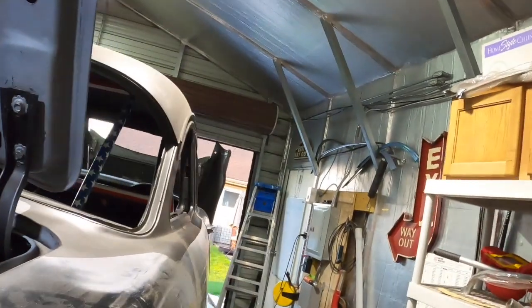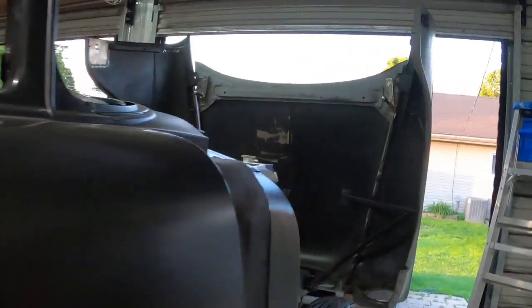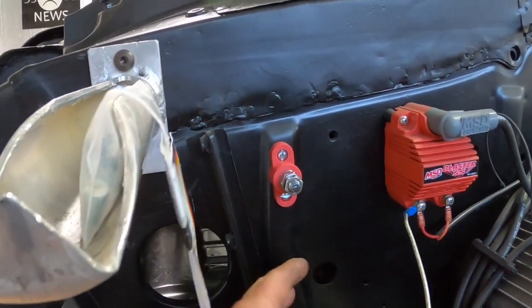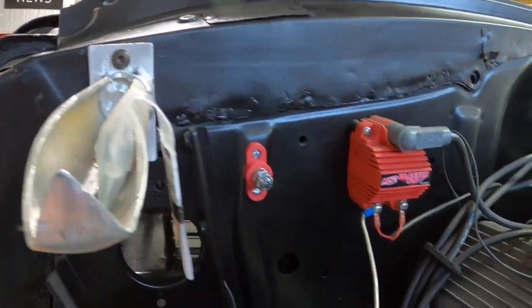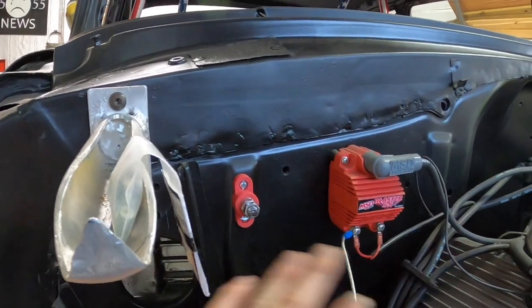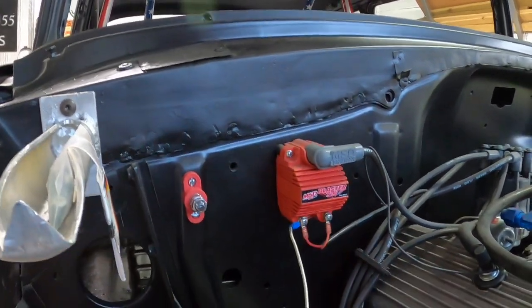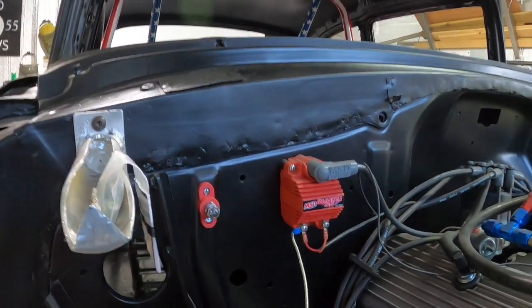We're about to do the lug on the front of the car just to have it done. I bought a positive post and mounted it right here on the firewall — I put it on the stamp so that in case I need to trim the studs off on the inside, the nuts are still recessed in case the heater box or something interferes. The battery tray goes right in this area on a stock '55 anyway, so I feel like we're in good shape right here.